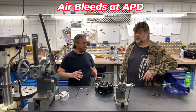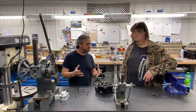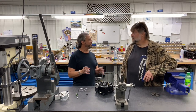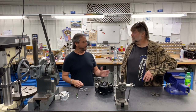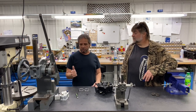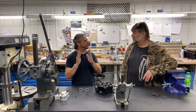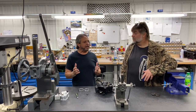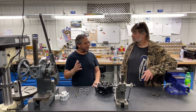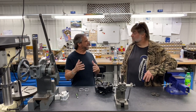Airbleeds. When I hear that word, I know nothing about airbleeds, John. I was always told as a tuner on carbs — don't mess with those, you don't need to tune them. You got to know what you're doing, you'll wreck your carb. I've never taken one out. I know there's a low speed and a high speed, at least in my experience with 4150s. I always thought it was associated with a circuit — low speed, high speed, that's a two circuit carburetor. And then the next one is like three circuit. I know dominators are three circuit — high, low, and intermediate.